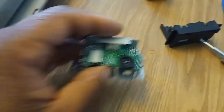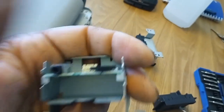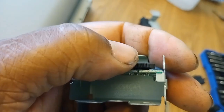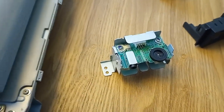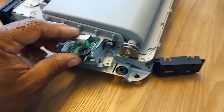You can blow it with a little compressed air if you want to, but you just want to get it cleaned. There's a little U-shaped thing in there that reads the board — you just want to get that cleaned off. Then the way you took it apart, put it back together the same way. Put the cover back on, plug it up first, then screw it back down. Do both of them and you're good to go.